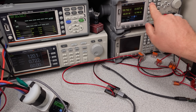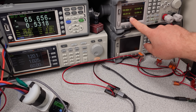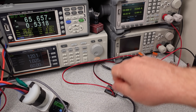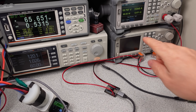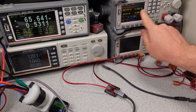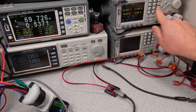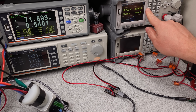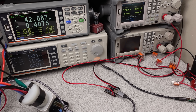Why the new mode then? The main claim is that it's doing more monitoring. It isn't monitoring the device really — it just gets told what to do by the device, but the device can say it needs less power. The new thing is the adapter can also say it can't supply that much power, so without turning off, the power level can be changed. This is inherent in power supplies and consumers anyway. The new operating mode is mostly related to temperature concerns on both ends, which is good. Cooler charging is more efficient charging, and it's always welcome. So that's my theory on why they did it — to manage temperatures better, which keeps the battery and the charger more healthy. I do have a new phone to test out this charger, so I'll give that a go over the next week or so to see if there are really any advantages or changes.